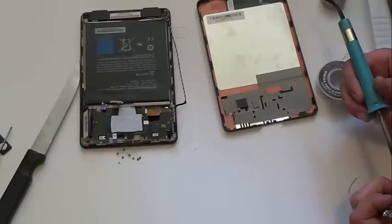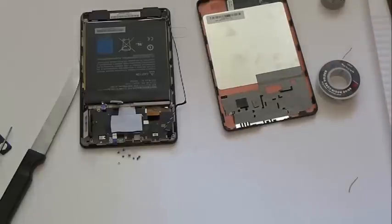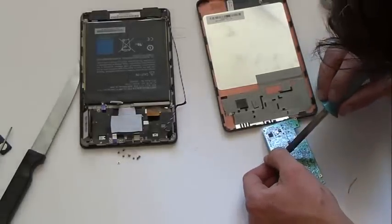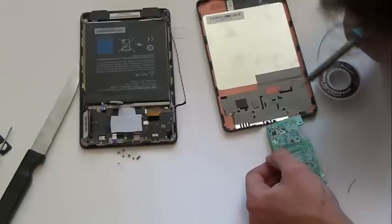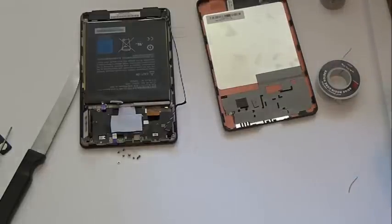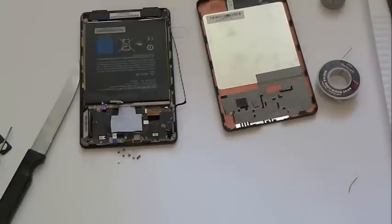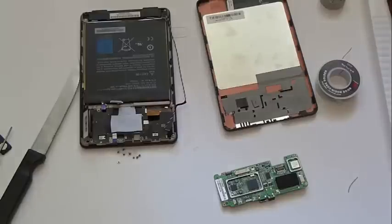What I do is heat them up from the back, and get that through hole to go through, get it to seat nice and square over those five connections. Once I get that to happen, I just go to the five legs, touch them, let them heat, and then drag off. Hopefully on some microscopic level that made a difference. The connector was extremely flimsy but now the connector's back on. Unfortunately there's no way to test this PCB as-is — we're going to have to put it back in the unit, power up, and see if we get a charge light on. I think it's going to work.